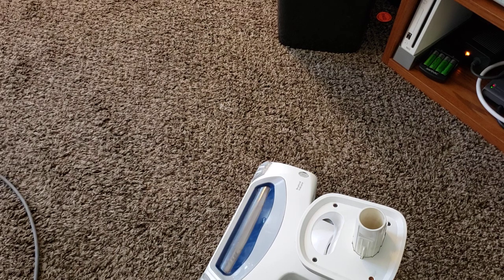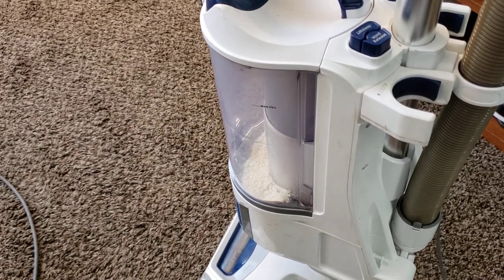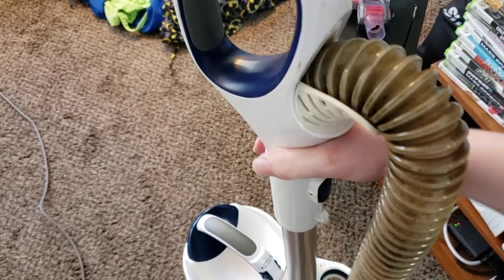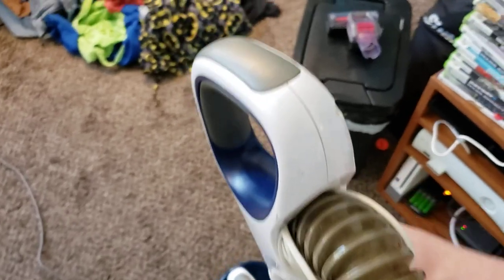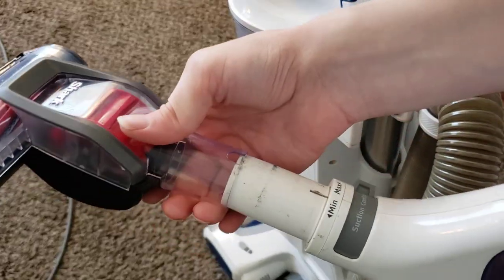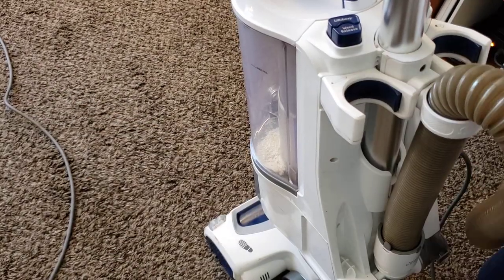This canister is rather bulky — much more bulky than the Navigators, but not nearly as bulky as the Apexes or the Stratos. So there is a little bit of a middle ground in terms of how maneuverable this canister portion is in lift-away mode. When you want to pull off the hose for tools, you can press this blue button right here — on some models it's red. Unfortunately, it doesn't actually click and stay like the higher-end Sharks do, so you have to push the button and actually pull out the handle, which is really tricky when you only have one hand. Also, this attachment fitting is different than a lot of other Sharks — they look the same, but other Shark attachments don't fit all the way, so unfortunately you have to use the special Rotator attachments.